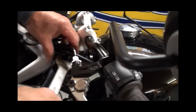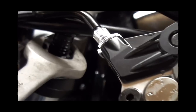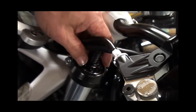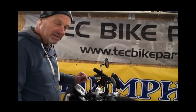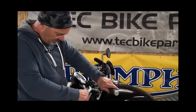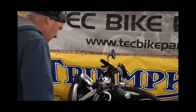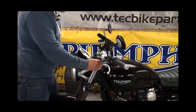As you can see, the adjustment is fully wound off there, so that'll be the lowest setting on the front end. Ideally on this bike, to get the steering a little bit better, we want the front as low as possible and the rear as high as possible — that'll pull the front end trail in a bit and make the bike steer quicker. It's got too much trail on standard, which is why it's reluctant to turn and makes the bike very stable. You want a little less trail to make the bike turn in faster.